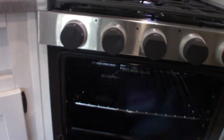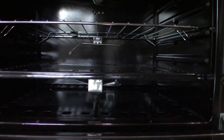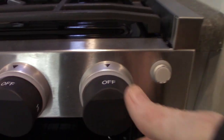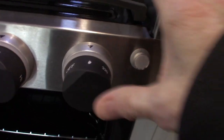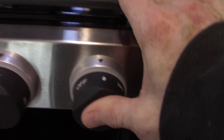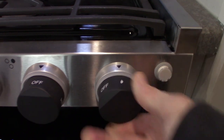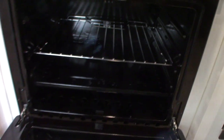The oven's a little different. Down at the bottom, all the way to the back, there's a pilot light. You go to the flame picture on the oven knob, depress it and keep it depressed, light the burner down there, and once you see it light, hold the knob for another 10–15 seconds for the thermocouple to heat up. Then you'll go to operating temperature. When you shut it off, the pilot light goes out, so you have to re-light the pilot light each time you use the oven. You also have a light here.